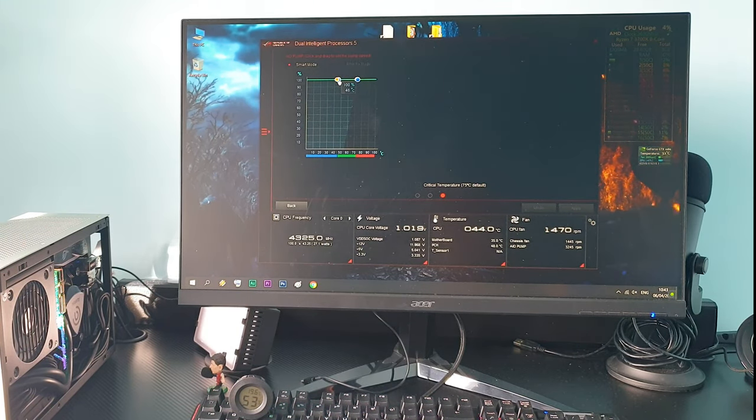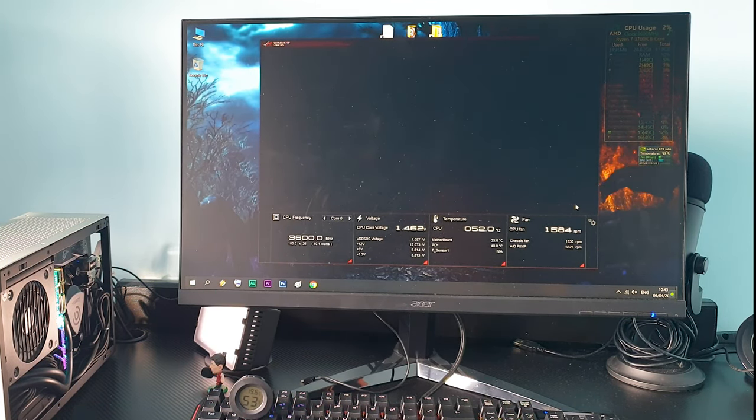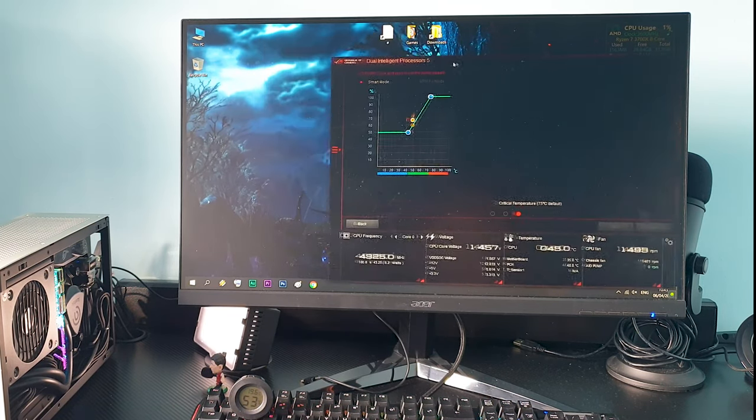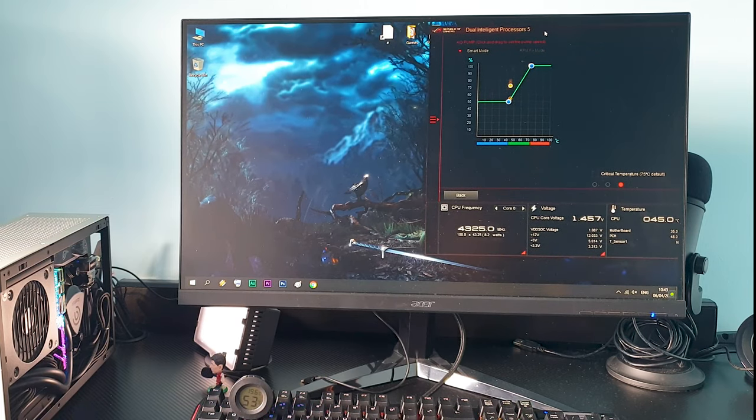As you can tell, it's very noisy and whiny. Which is understandable, but in idle and light load, this gets very annoying really fast. Luckily, I can control it, like I say, with the software, and now everything is heaven again. Basically, now it's on PWM mode, which is exactly what we need. I discovered that up to 80% RPM, the pump is really silent.